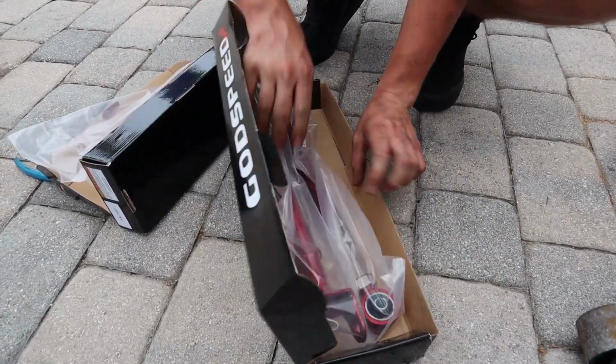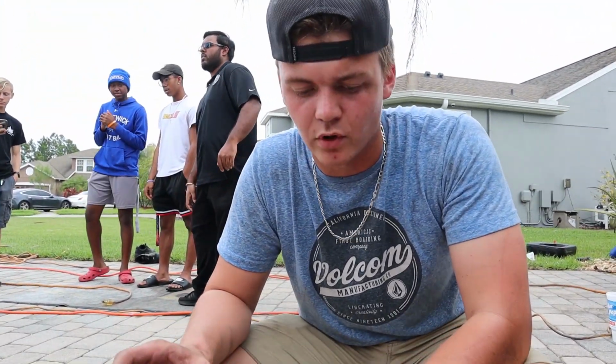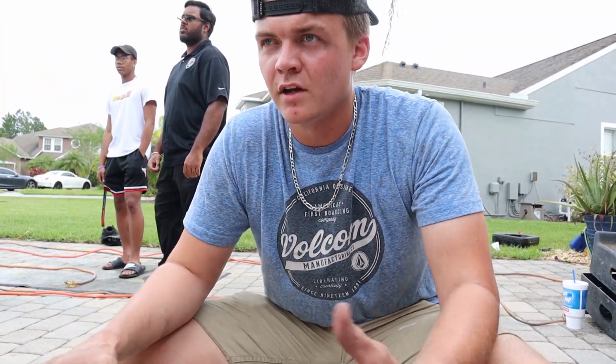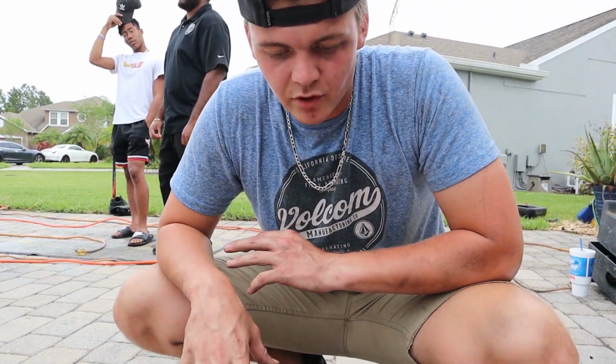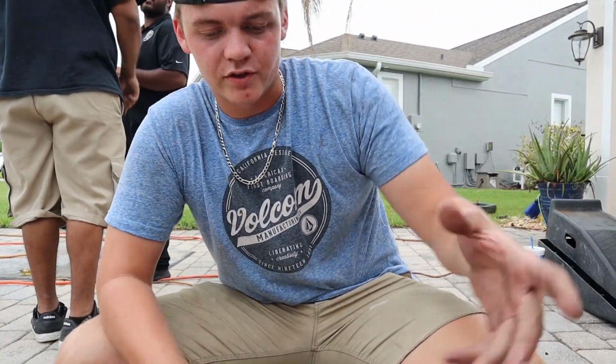So with just the toe, the camber, and the traction arms, which are the three lowers on an LS400, a buddy of mine's running them, and he's at -14, but I have bigger lips, so that's why I'm doing the shortened uppers. But yeah, this will be able to give me more camber, adjustable on top of whatever the uppers are. Also save a bunch of money.